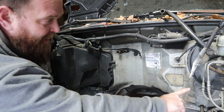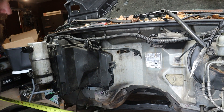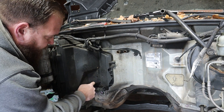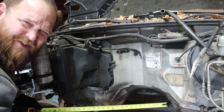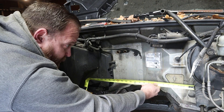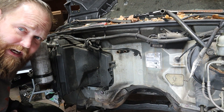I'm going to measure from the steering shaft over to the air box in a couple of places to see how much room we bought for our investment. Back in the day doing these conversions we'd have to cut a corner, epoxy it in, and it just never really looked good — so if I can buy something that looks good, that makes me happy. Right there is 23 and a half inches, and about 25 inches, measured from the steering column shaft.